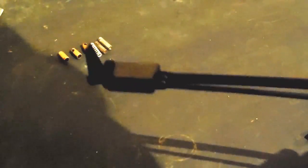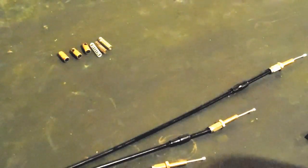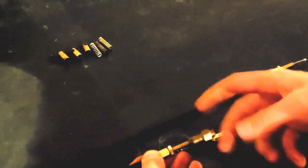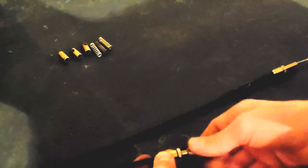Here's our new choke cable — it's got this all together here. It's not an OEM one, but we'll just try it and see how it works. Let's put the ends on it: you have your brass end, just slip it over and screw it on. Screw it on as far as you can — that way it makes getting the plungers on as easy as possible.